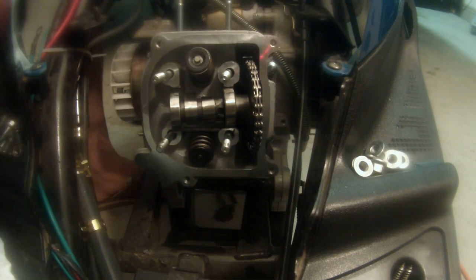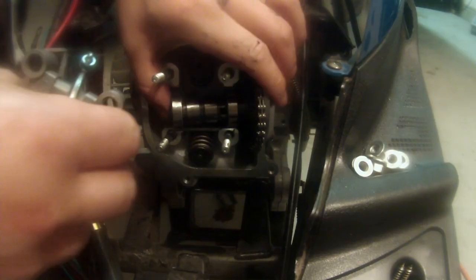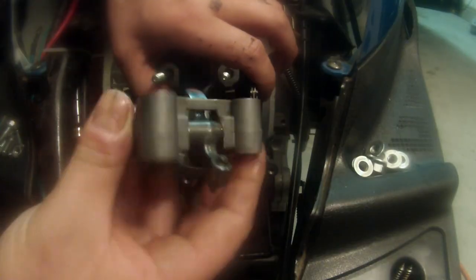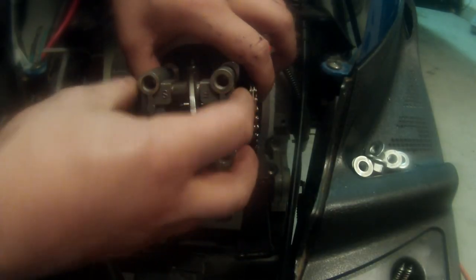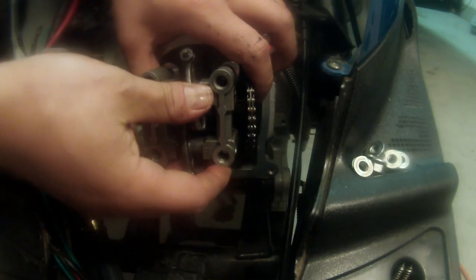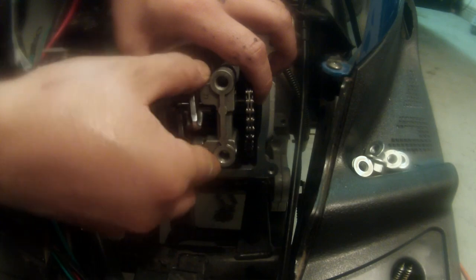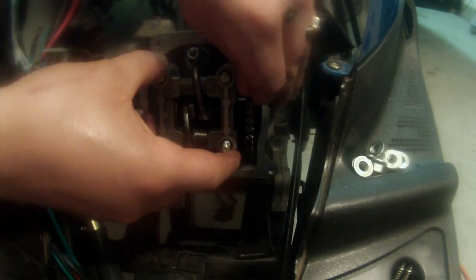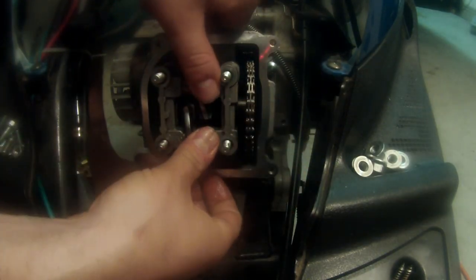At this point we can put our spacers in — we have a spacer and a spacer. We need to put our rocker assembly on. We're going to make sure this guy's lined up nice. There's not notches or anything that hold it on that one, but there is on this rocker assembly, so when we put that on it should give us not much of a choice. You have to kind of hold these rockers up so it doesn't bind it all up. There we go. Then you want to kind of wiggle your sprocket and cam — make sure that it's seated properly, and in this case it is.